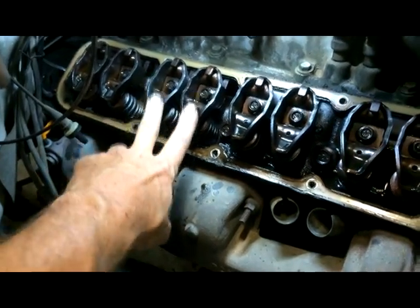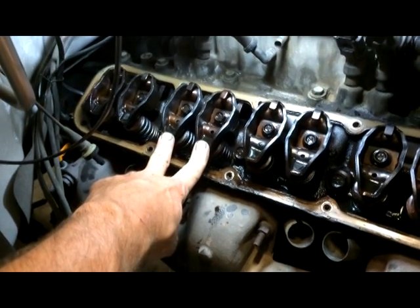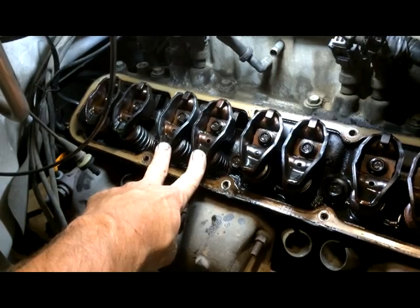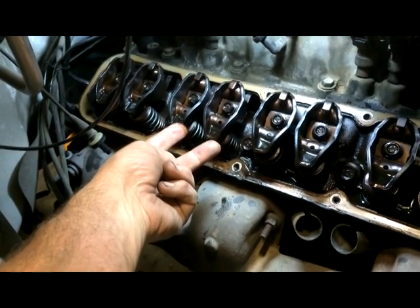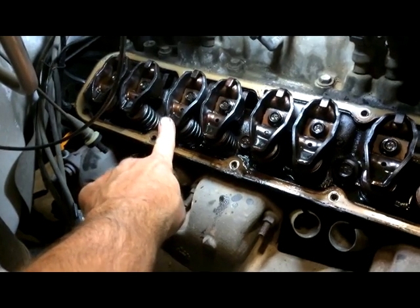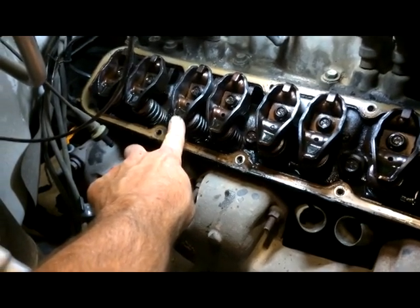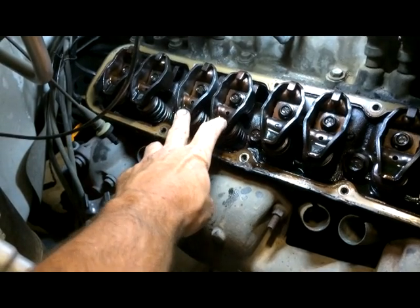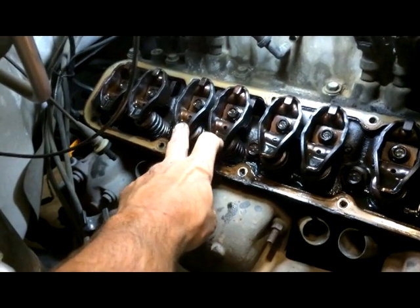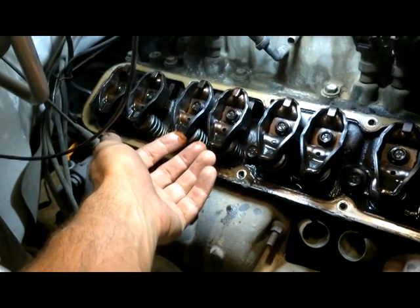What we're going to do is make sure that these two valves are closed. How you do that is you rotate the crankshaft and have somebody watch to make sure they're both in the up position. Ideally, you want to watch the intake valve — it will go down and it will come up, and then there will be a duration of time when neither one will move. You want to stop right there, and that means that both of these valves are closed.